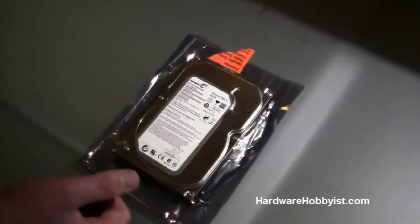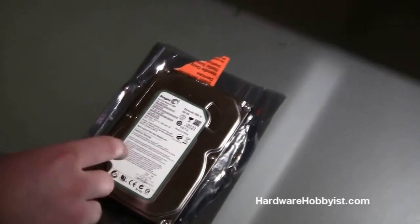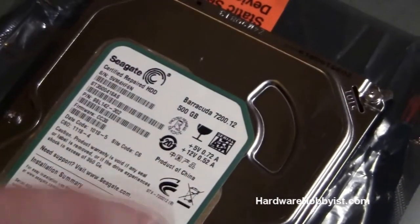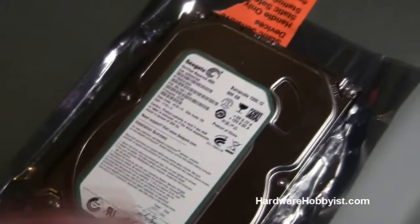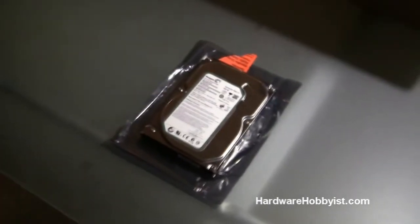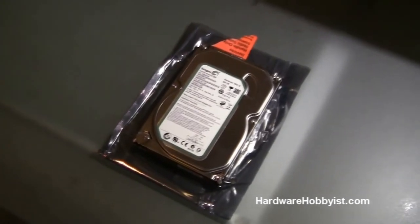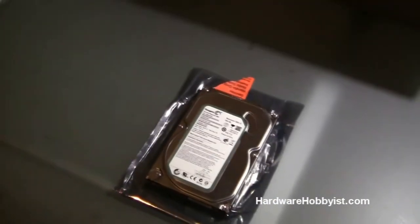You have your RPM, which stands for rotations per minute — that's how fast the platters spin. The higher the RPM, the faster your data read and write speeds will be, because the read head can find files quicker when the discs are spinning faster. Pretty much 7200 RPM is standard on almost everything. Notebooks use a 5400 RPM standard because they're smaller and need to consume less power. You can also get drives like Western Digital's Velociraptor, which runs at 10,000 RPM, and that will increase your read and write speeds a bit.